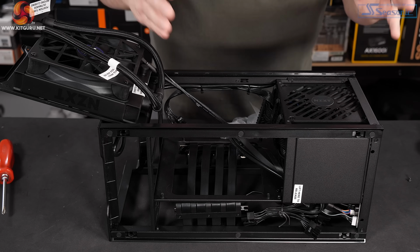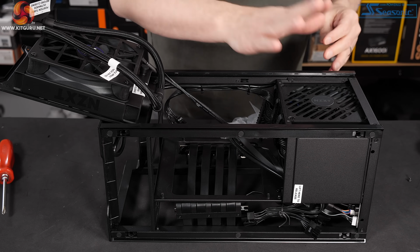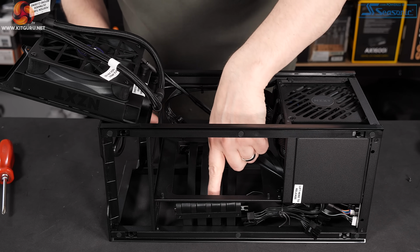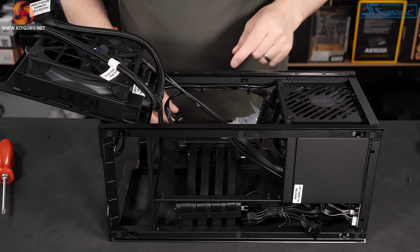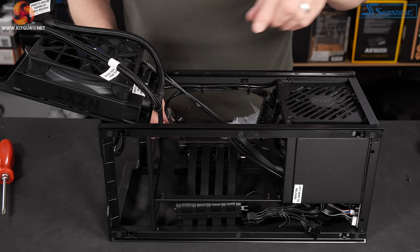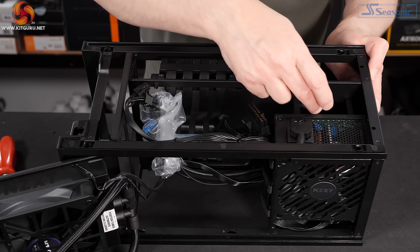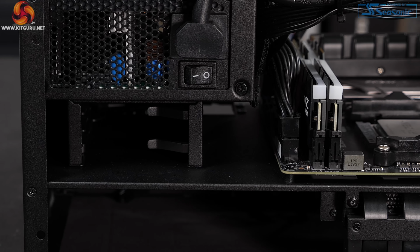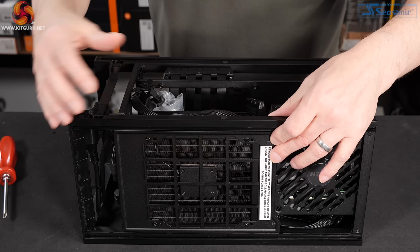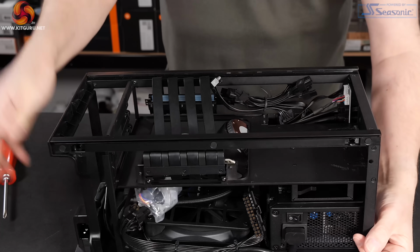As you can see, what we have is a chassis that has the CPU cooler already installed. It has the power supply already installed. The cables are already routed. There's a PCI Express riser cable for the graphics card, so we need to choose a motherboard and processor, install it here, install the cooler. If you choose to install a SATA SSD, there are a couple of bays there above the power supply. So really the choice of components boils down to motherboard, processor, memory, SSD and graphics card.